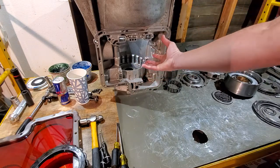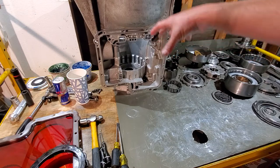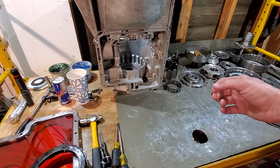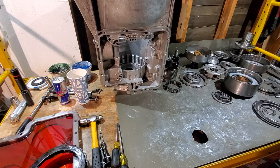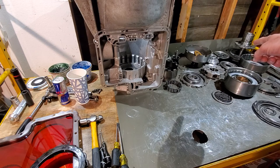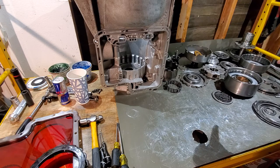There are a few different ways of doing it depending on which setup or case you have. Sometimes you can just take the whole thing with the race set on top and tighten the race down. This one in particular, we had to put the lower reverse piston in, put the race on, bolt that in, then do the individual spring cage and snap ring, then press everything down for it to lock in. We've already put our metal clad sealing rings on everything — three large locking rings on the stator, two small locking metal rings on the back of the forward input drum, and three large non-locking metal rings on the governor housing on the output shaft.